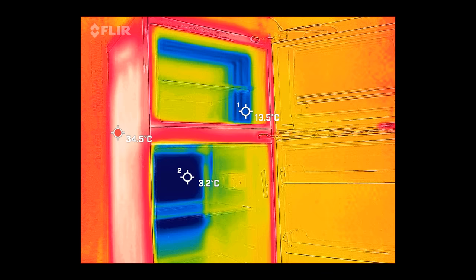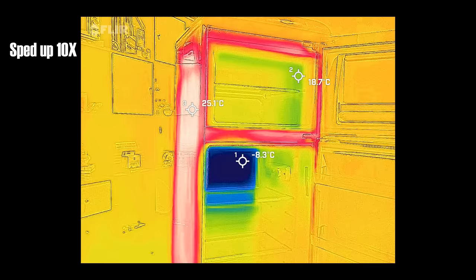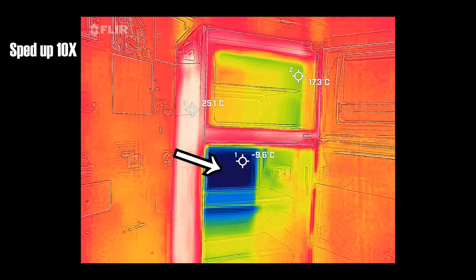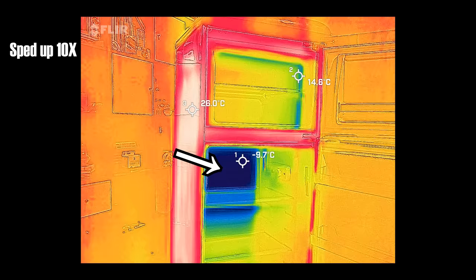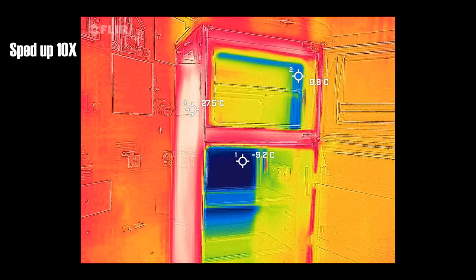Isn't this just so clever? This is an extremely elegant way to make a single refrigeration circuit maintain two very different temperatures in two locations with no moving parts. I would never have thought that splitting the evaporator into two sections in series like this would work, but it does. There are, however, downsides of course. When the compressor first kicks on, only the fridge section gets cold. It takes a while for the freezer section to start seeing liquid refrigerant, most likely because at startup the refrigerant lines and walls are so warm that the refrigerant can get all the energy it can possibly absorb from right here. Only once this section is actually cold does the freezer start to see any cooling. That's not a huge problem, but it means we need fairly long cycle times to ensure the freezer works properly.